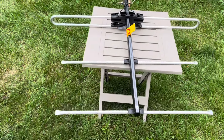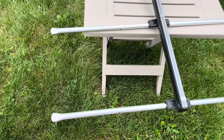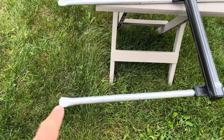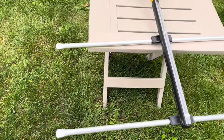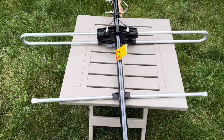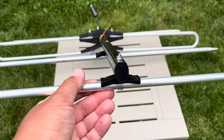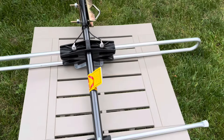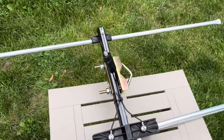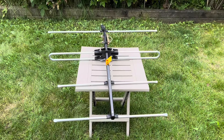This is a very well-built TV antenna. The elements use a larger diameter tubing than you normally see on outdoor antennas. The finishing on the ends is nice and neat, the crimps and the folded dipole are neatly formed. The powder coating on the boom has an elliptical shape that makes it rigid, and the mast clamp looks heavy duty with a larger diameter U-bolt. Overall, excellent build quality.